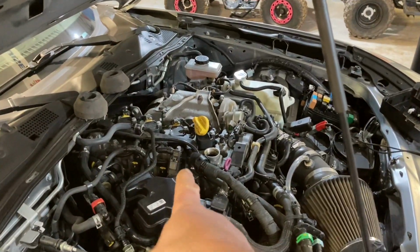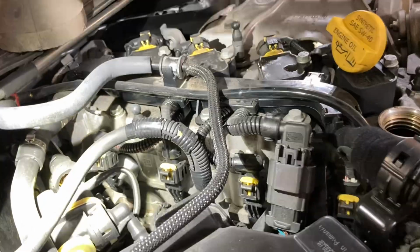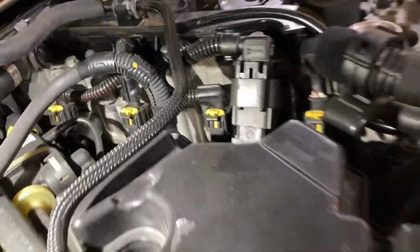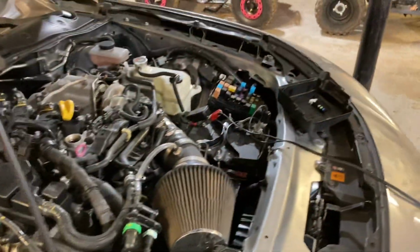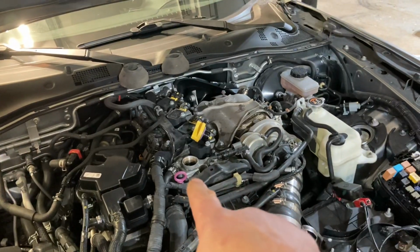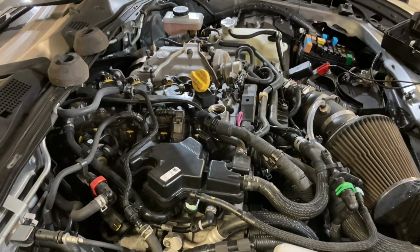what happens is the top of the engine, that basically down in here, that works your valves, there's little hydraulic solenoids right here that control your intake valves. They will not turn on because the oil drains out of the top of the engine down. You lose your prime, they're not going to open.